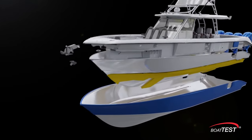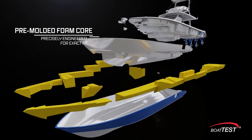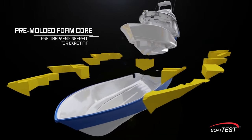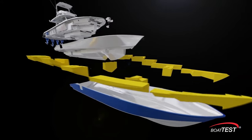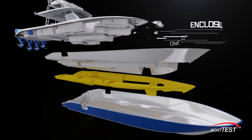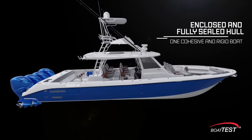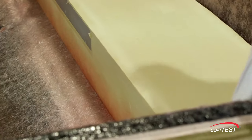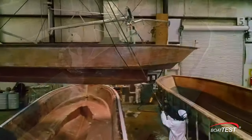The centerpiece of this boat's construction is Everglades' patented RAMCAP process, utilizing pre-molded high-density foam blocks three times stronger than the industry norm that precisely fit between the hull and the liner. It's this foam construction method that makes the 315 unsinkable, but it will also float level if swamped. Only a few brands can say that, and Everglades is one of them. Fiberglass is sprayed between the hull and the foam, and the three elements are then vacuum fastened together and cured over 24 hours into one solid rigid unit.